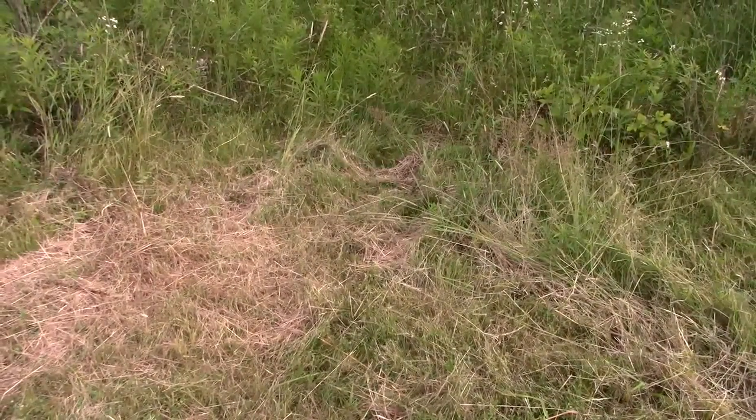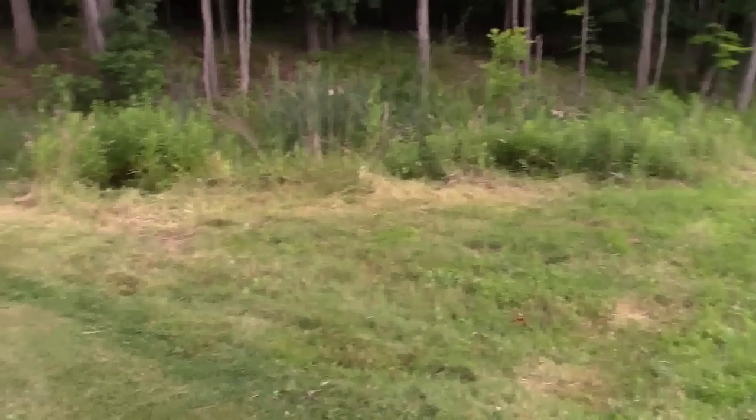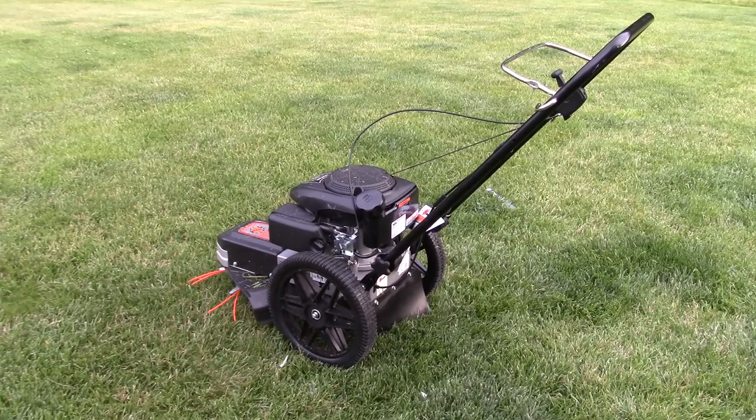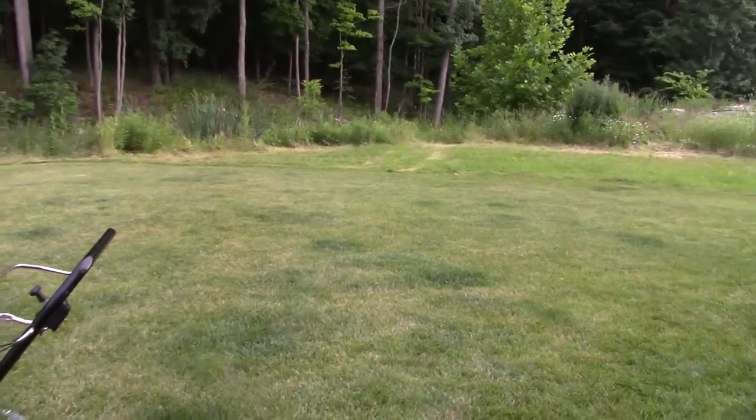Let's wrap this portion up and do the final review. Just to let you know, I cut down a lot of this field area with this machine and it didn't take that long. All in all it's a very heavy-duty, well-built machine — the Kohler motor is great, you can't go wrong with Kohler. I think I addressed some of the issues people were having. With the very heavy stuff it does tend to wrap around a little bit, but you'll get that with any string trimmer. All you have to do is tilt it up and it'll spit it out and you just start again. To be fair, I was using 155 mil — I should have been using 175 — but as you can see it cut down a lot of that area.